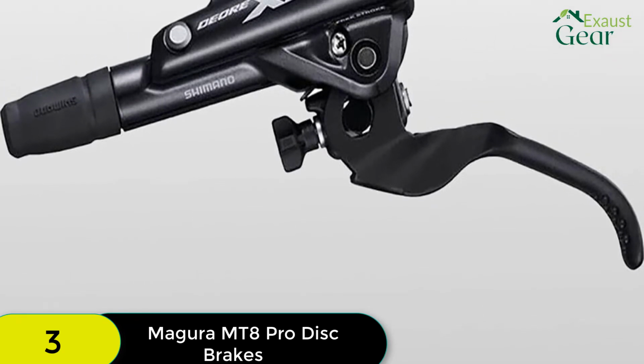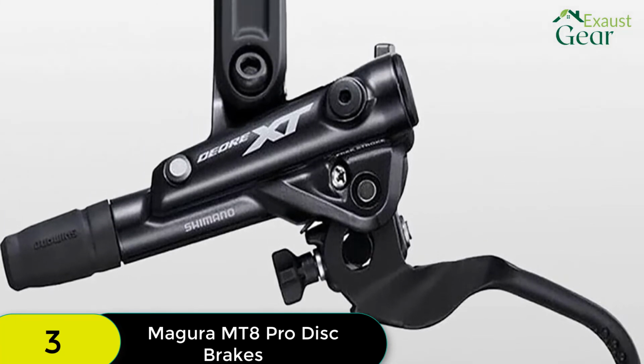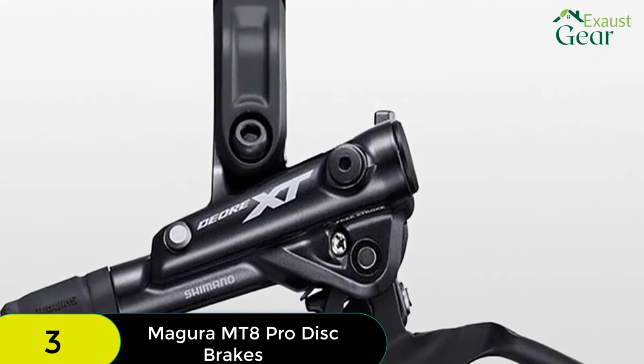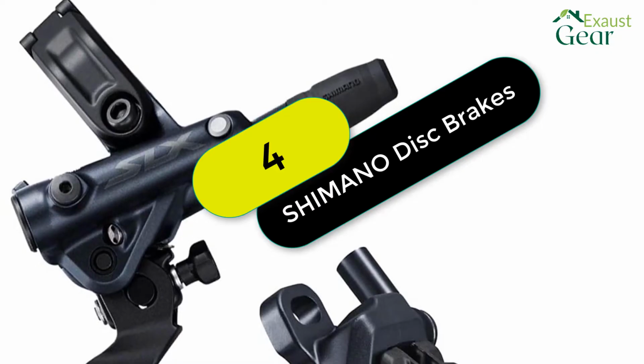After 700 miles of enduro riding, I have not had to mechanically center the brakes at all. I can't say that about SRAM Guide hydraulic disc brakes or either of the Shimano models. The calipers are also forged out of one piece of material rather than being a split design, which makes them stiffer.